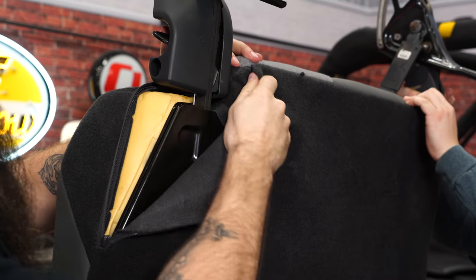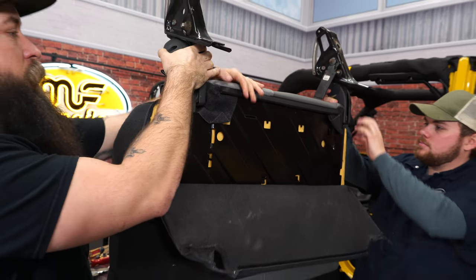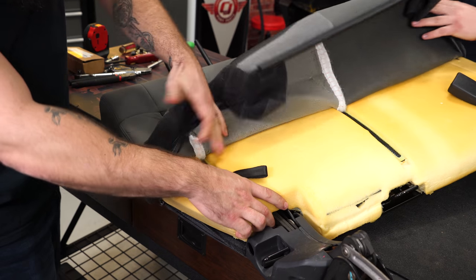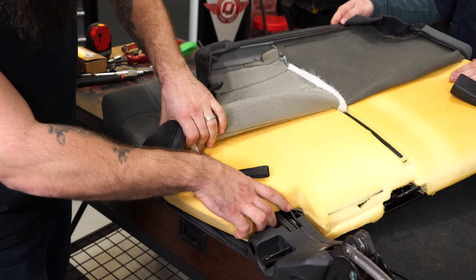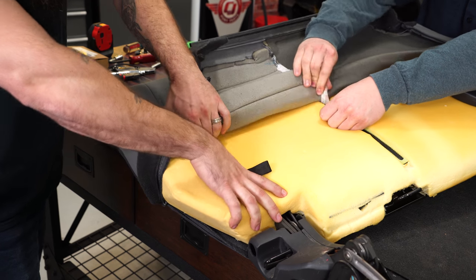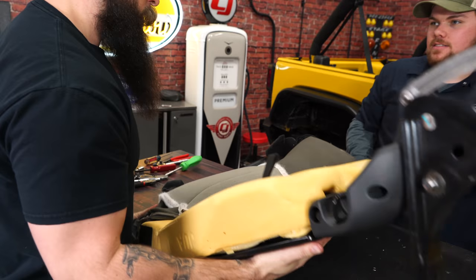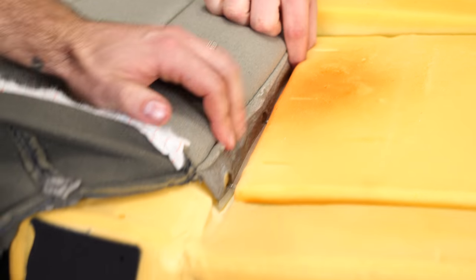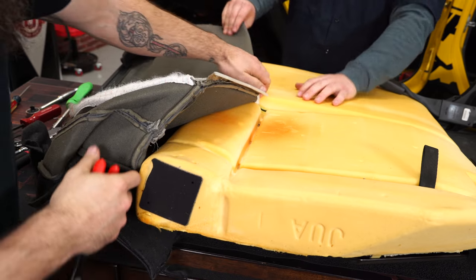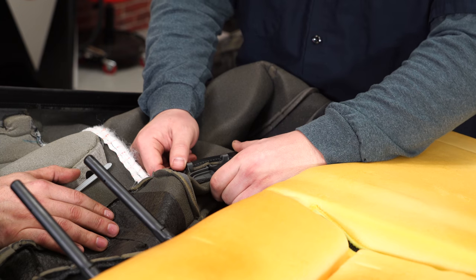There are little silver button tabs — push them down at the same time to release and slide off the headrest. Down by the hinge there's a zipper tucked in on either side — there's no tab on it so use a small flat head to run it up and unzip the bottom portion. Once you've unzipped the zippers you can reach the J-hook — it pulls apart just like the bucket seat bottoms. In the channels you've got Velcro on the rear seats, so put a thumb down and make sure you don't pull the Velcro out of the foam — it is 10 years old. There are also three hog rings hidden towards the top that need to be unclipped. Remove the seat belt retainer so you can install the new TMI upholstery kit.